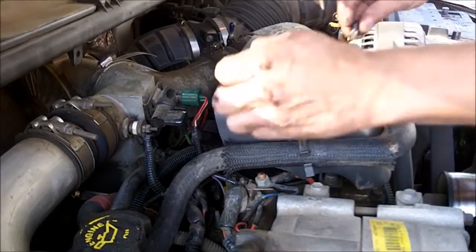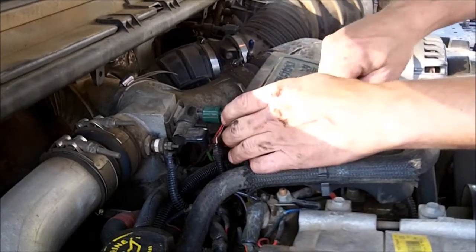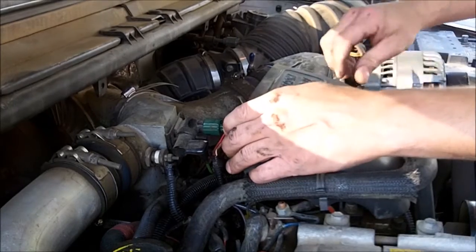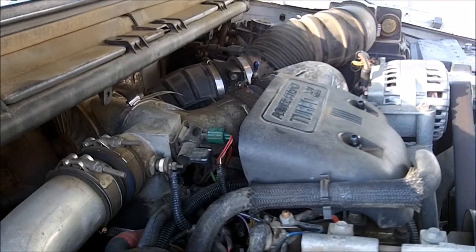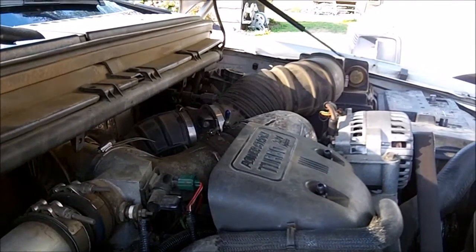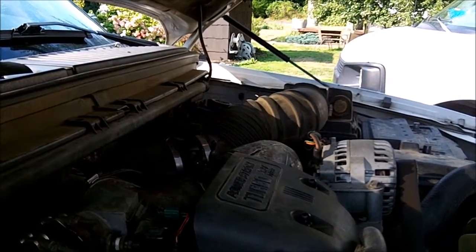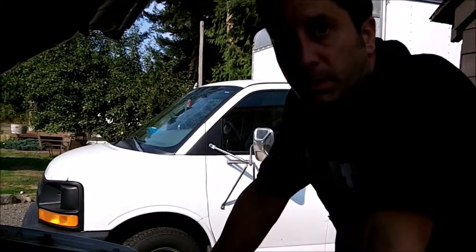So I would say this is probably a 1 hour job. About a 1 hour job, and it took about 1 to 3 hours to diagnose. Running a hard fuel pressure test and watching when fuel pressure fluctuated, and then the voltage we're supposed to get from this ICP is about 1/4 volt. You can hook up your scan tool and read the live feed, and you should have 0.21 volts coming from the injection control pressure sensor on this particular vehicle.